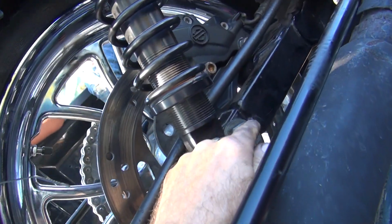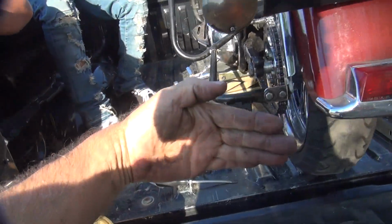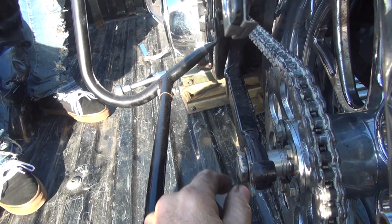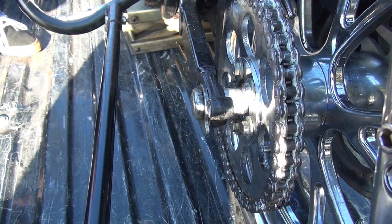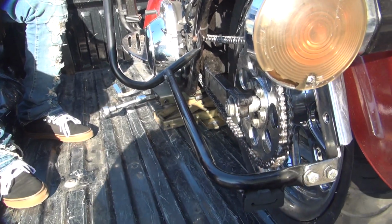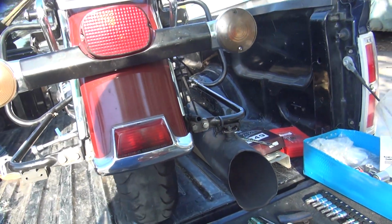So we need to grind the swing arm on this side and take out probably a 1/16 of an inch out of that frame right there to get this wheel where it sits straight. Now this here, I tied it up until it got tight, so I had to squeeze the swing arm a little bit, which I don't really like doing, but you're not going to kill it by doing it that little amount, but it's something you don't want to get in the habit of doing. I'm not exactly sure where the sprocket is right now, centered to everything else, but until we get the wheel more straight, we can't see where this offset needs to be different than what it is. So now you're going to take it all apart and do some grinding.